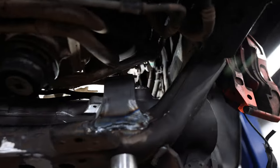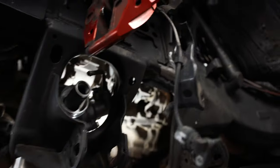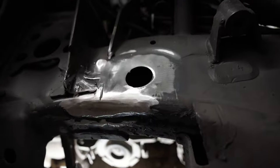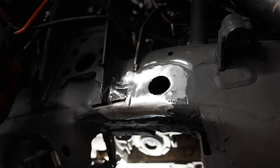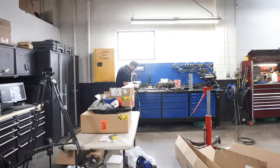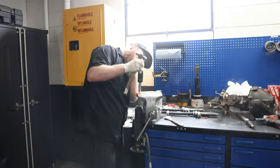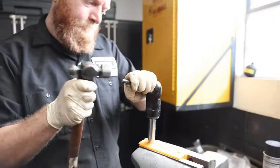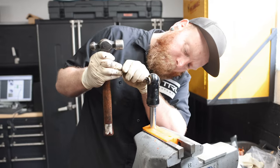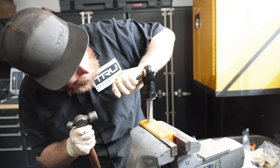Everything welded in for this steering rack reinforcement. He's got the old bump stop location cut off, ground down for the new one, and currently is working on changing out the rod ends on the shock, since the rod ends and the cups are going to be slightly different geometry wise for the Marlin Crawler kit.